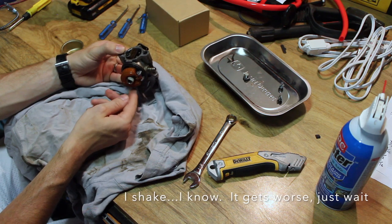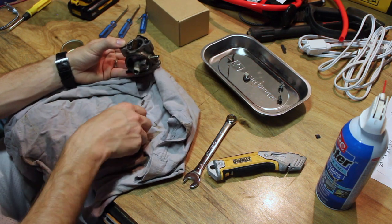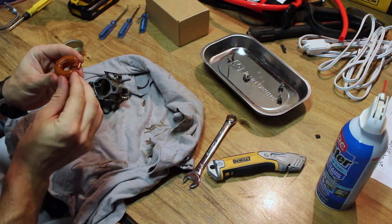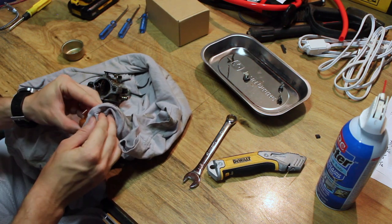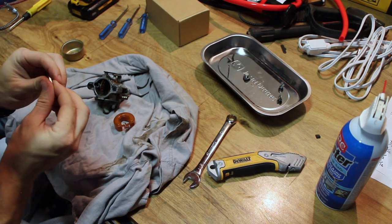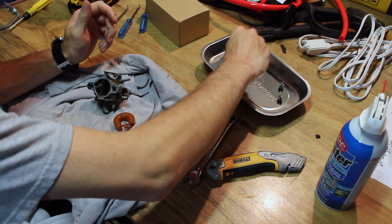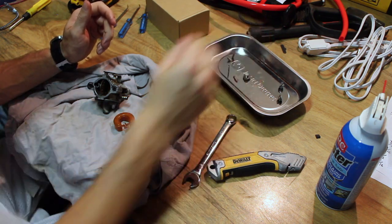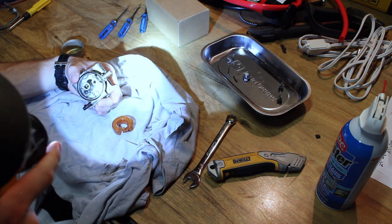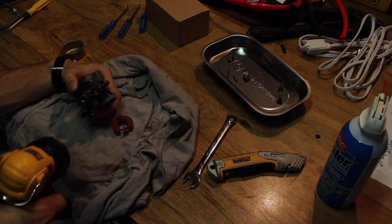That means the float isn't hitting the pin properly. So what's our float situation look like? Is our float not floating? Without dumping that in water I'm not exactly sure how to find that out - I might have to dump it in some water. And then our pin stop looks okay, I'm not going to try and take that apart. That's aluminum - not magnetic. The jets are working, so I think it's just the float.